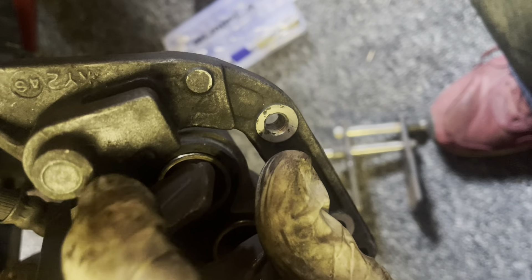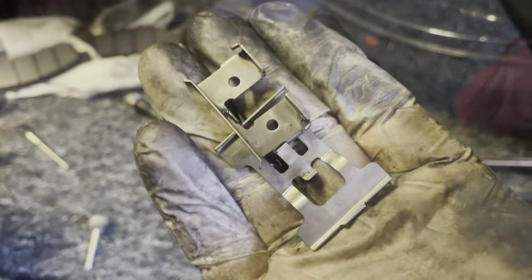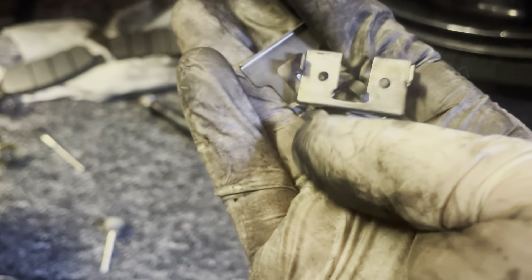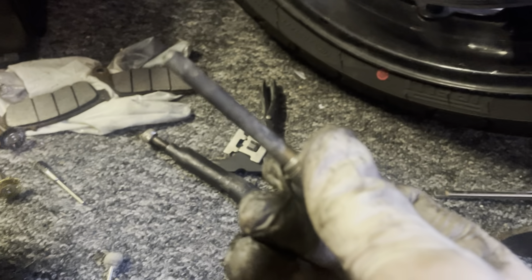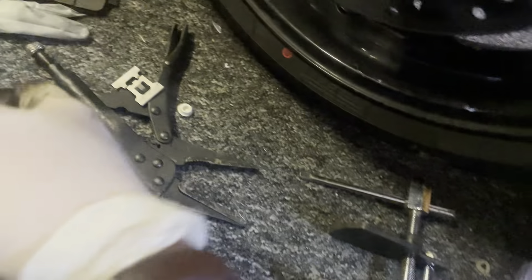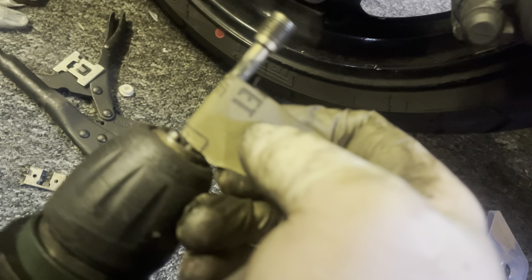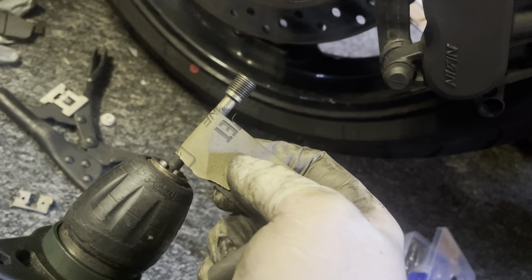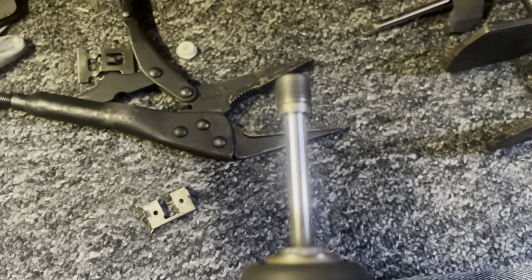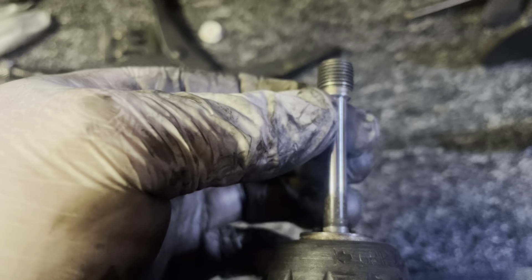It's an amazing difference. We're going to clean up all of the areas where the pads run against the inside of the caliper, clean up the caliper slides, and then get it back together and do the other side. The spring's all cleaned up. One last thing I need to clean up is the actual slide pin — I've got a little trick for these. I've popped this in the end of the drill chuck. When I turn the drill on it will spin, and then I wrap a little bit of emery paper around the end of it. When I run the drill I can move this up and down and it'll clean up all the gunk. What we end up with is a smooth surface, which gives a really nice surface for the pads to slide along.